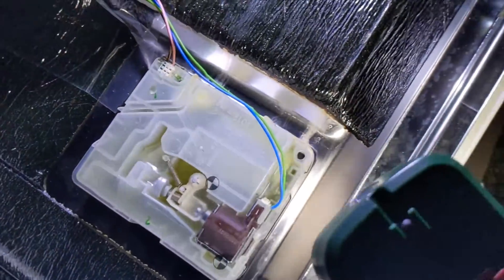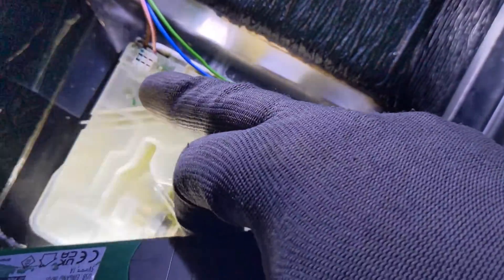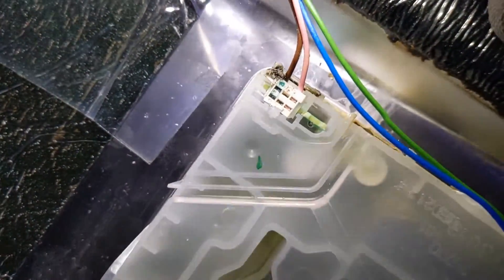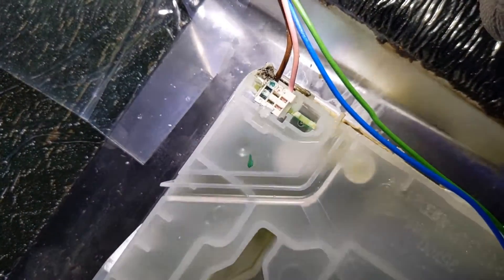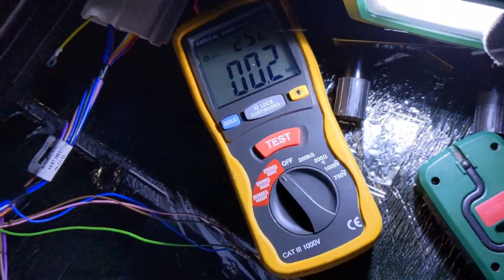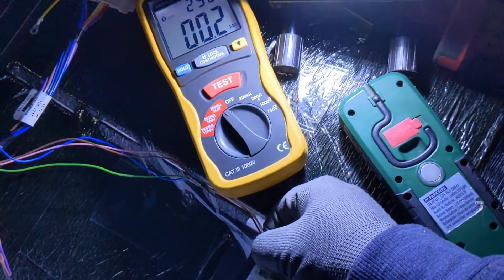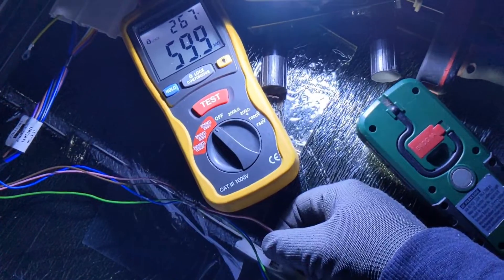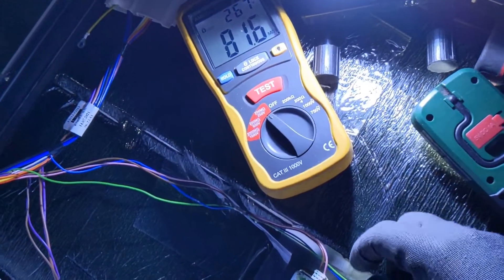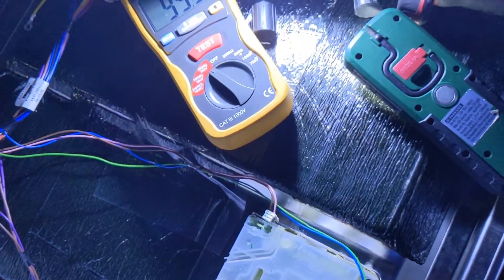It's Ryan here from RLF Vacuum Cleaners. Through the process of elimination and disconnecting everything and testing, I've taken the front panel off the door completely — obviously earlier I didn't quite open it enough. You can see there's burning and corrosion on that little connector and circuit board there. And what happens is, with that circuit board connected you get nothing. Now if I quickly disconnect it, wiggle it out gently — try not to electrocute yourself — the IR readings start going up. So I believe this is the fault. This looks to be on the rinse aid container — it's all sticky and horrible, so it's obviously sprung a leak, shorting that connector out.